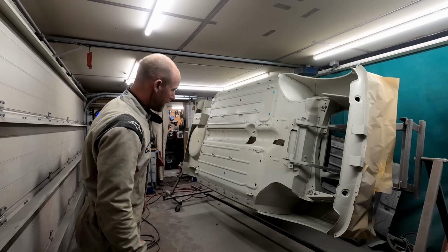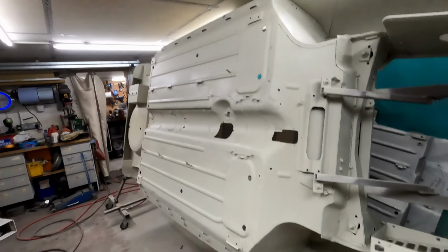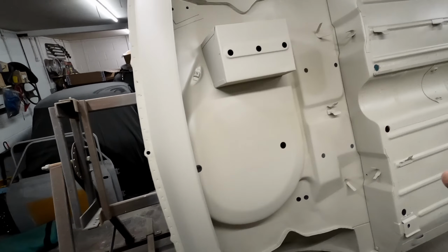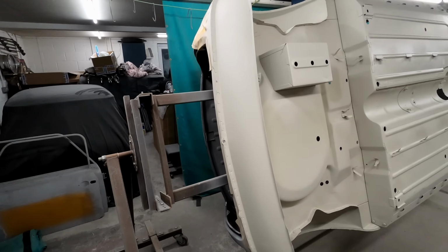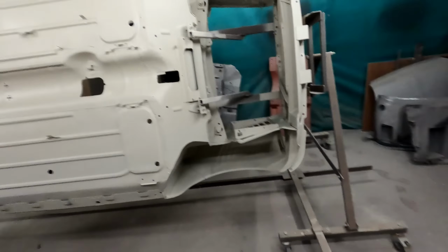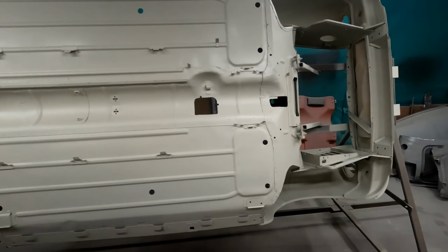It's actually got quite good coverage. So why did I do what I did? I've put an epoxy primer on the underside, on the rear valance, because I am going to stone chip that with coloured Raptor, and I'm also going to stone chip the front. Sorry, battery ran out. So I'm stone chipping the front, the rear valance, all the underside, and the arches, front and back.